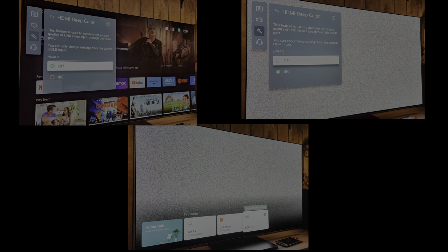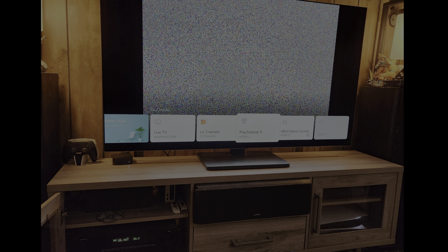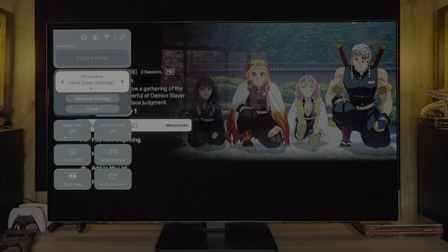Moving on to handshake issues and general bugs — this won't affect everyone, but they were experienced during this review. Static appeared frequently; turning off deep color seemed to fix it but would disable HDR features, so that's not a viable solution. There were also incorrect input labeling issues — the Xbox showing as plugged into the wrong HDMI port — and duplicate HDMI entries falsely showing a DVD player connected. There were also Xbox HDR handshake failures requiring repeated game relaunches. These are the same issues the G2 and prior LG models suffered until eventually fixed with firmware updates.